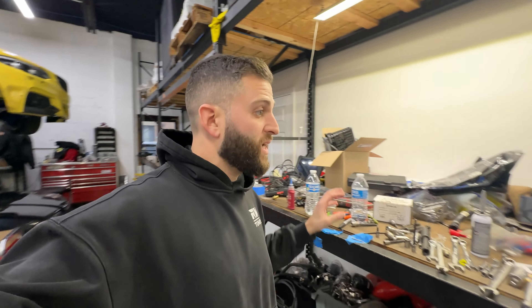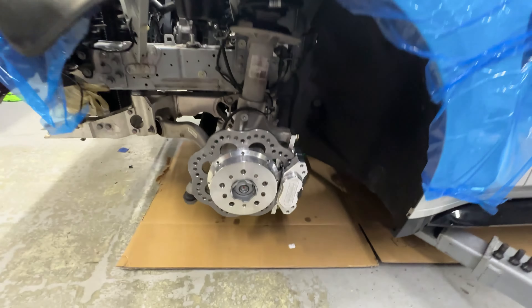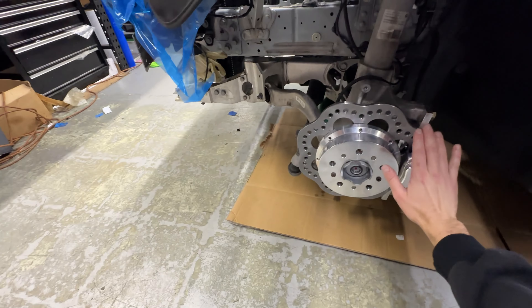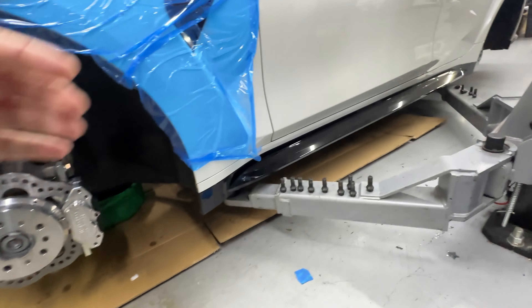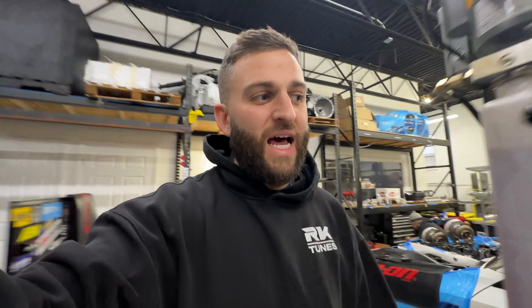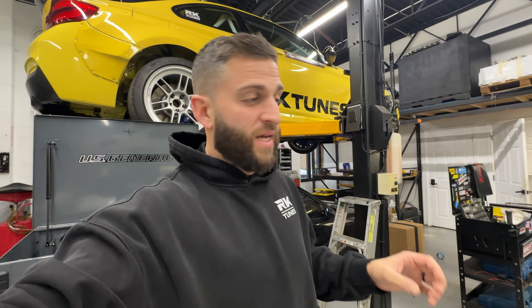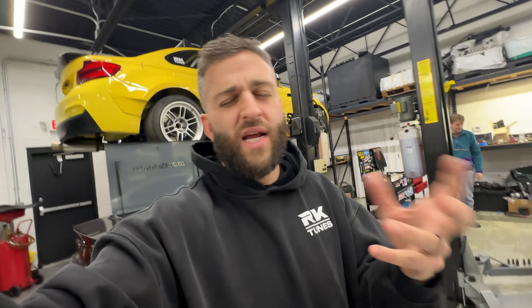We port-matched the throttle body a little bit after welding, not the throttle body itself but via the adapter plate. We have my original ECU unit still and the other one on the bench — we'll put in a flash to make it work. The brakes are done. They look ridiculously tiny — like next to my hand it's just ridiculous. I think the car is still going to stop because it has super aggressive pads. We have a link below for brake options — street rotors, drag ones, and drag super-lights, which is what I bought.